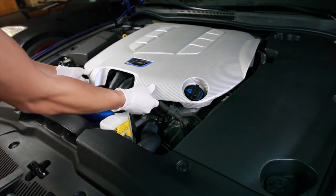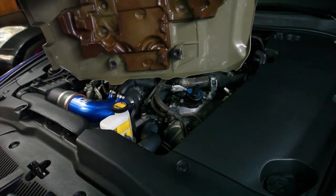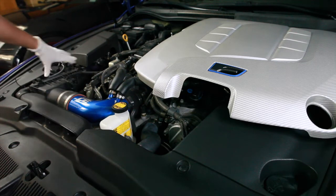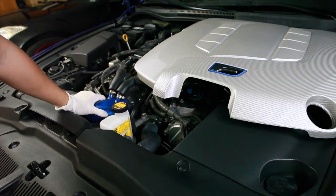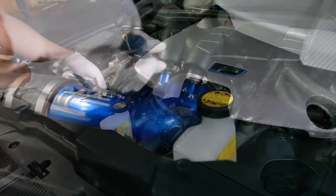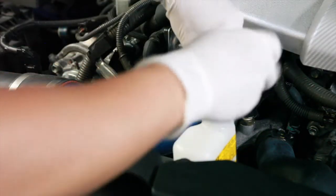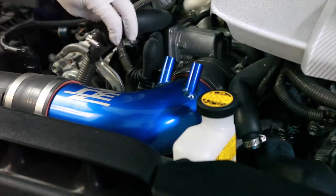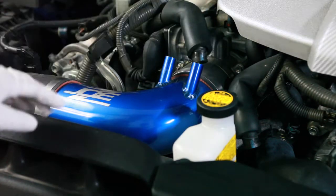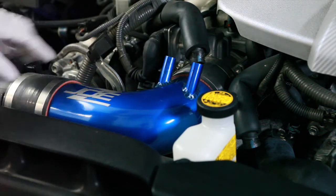You want to go ahead and firmly pry this up — it should pop right off — and then there's two more in the back. So you have one, two, three, and four. Next, we're going to remove the intake arm. Most people could just pry these two clips here, but I'm going to make it easier for myself and remove this. Use your flathead and start twisting these off. You can grab these clamps and put them aside on the grill so you don't lose them. Then loosen up these two flatheads up here and the one holding this in place.